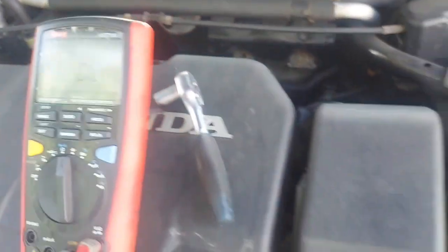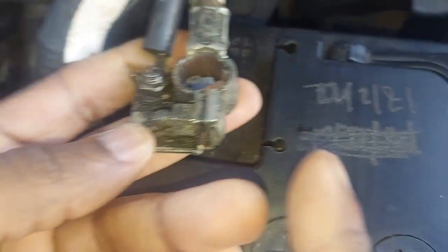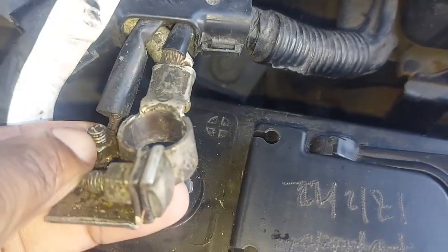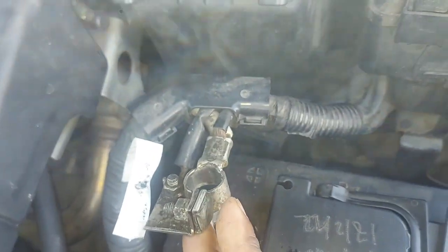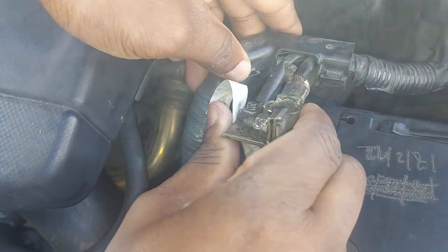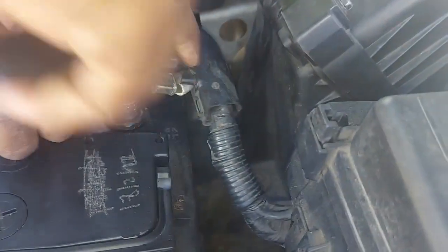So here's what we're going to do now. The next thing is, which one of these is shorted to ground? I want to isolate. If you can check, we have these other wires that are coming in here. We've got that one there. I want to see if I can just test this big wire that goes to the alternator. That's what I want to ascertain and see which way I can do that. Maybe let me isolate this one. Isolate one of these.